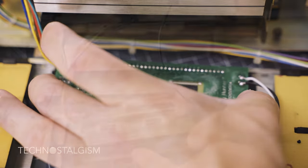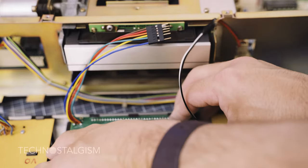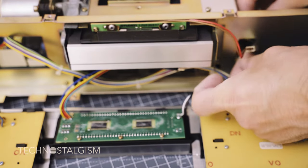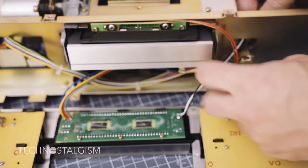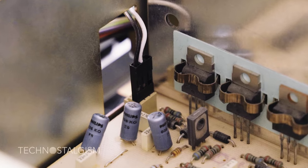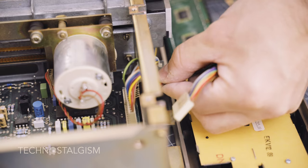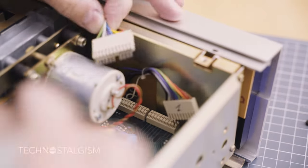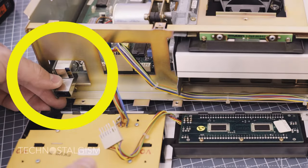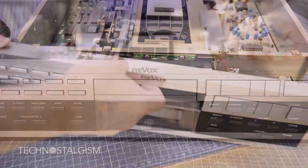Anyway, this is something we'll revisit eventually. For now, let's put the display frame back, making sure the clips are aligned so everything clicks back into place. The backlight wire goes through the cutout and plugs into the socket originally powering the bulb. It's a 3-pin connector with only 2 pins to help determine the correct orientation. The display connector matches the original pins exactly. I had previously numbered all connectors to avoid confusion. Make sure the infrared receiver is straight so that it can slide back into its slot when mounting the front panel back.